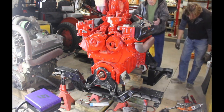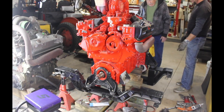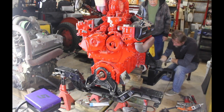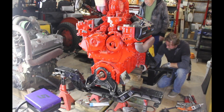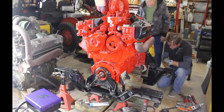Well, you're going to pick it up here, you're going to lose the pressure then. Well, there's no pressure on it now. It's sitting on the block. You should be able to tighten it down on it. But see this gap under the bushing? It's swelling up because you're tightening the nut up. They don't have stops in there for that, though. They go so far. So it's got to be sitting down on it so it pushes the rubber all the way into this beam.